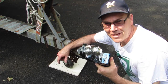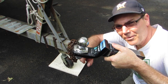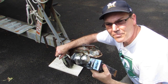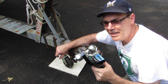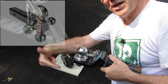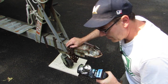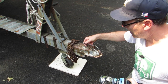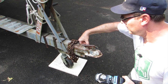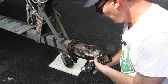One of the things that's important is to have a hitch receiver on your vehicle, a hook up for wires, but also you need to make sure you have the right drop and the right size ball and receiver to match up. The hitch balls come in a couple of different standard sizes — like inch and seven-eighths, two, and I think two and a quarter. They actually make balls where you can get one with four different sizes on them, so you can hook up to a variety of trailers. Every trailer will say on here what size receiver it has — this one says it's a two-inch receiver, so you need a two-inch ball to match up with a two-inch receiver.